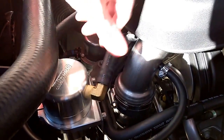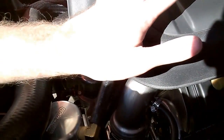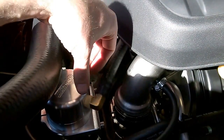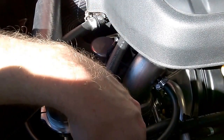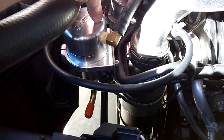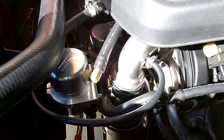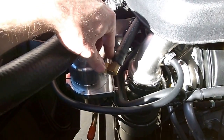The more advanced technicians in the diesel field who rebuild and clean the emission system — intake valves, EGR, and turbo vanes on VNT turbos, especially like the Fords and Volkswagen TDIs (which this engine is pretty much the same as) — will already tell you about the importance of oil separation. I don't know why this engine doesn't have this already built in, but what surprised me was how well this Moroso separator is doing. And note that nothing is interfering — this is not touching that radiator hose. It looks completely factory and was very easy to install.